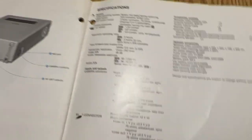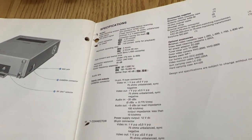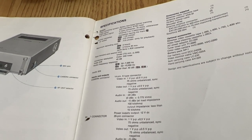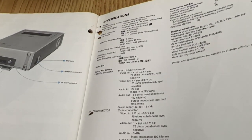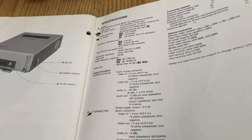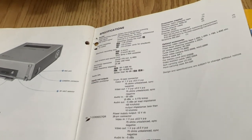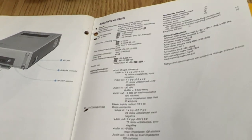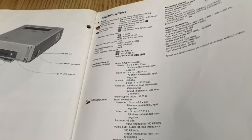The last page of the manual has the specifications. Fast forward and rewind time is under three and a half minutes. This one actually lists horizontal resolution at 240 lines. If you record in monochrome it actually got 250 lines. VHS, no matter what, was stuck at 230 — and on analog source that's a pretty big difference. Super Beta boosted the horizontal resolution to 290 lines, while VHS HQ couldn't get it above 250.